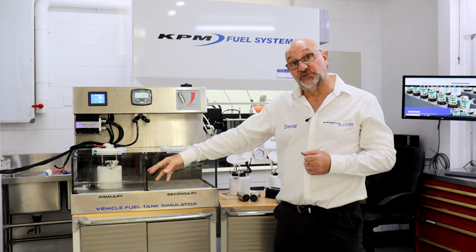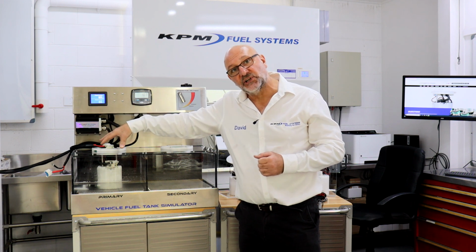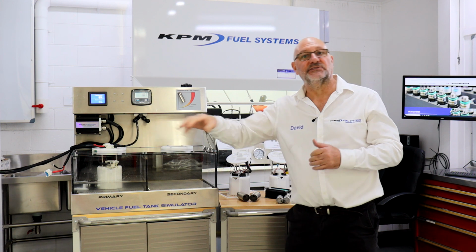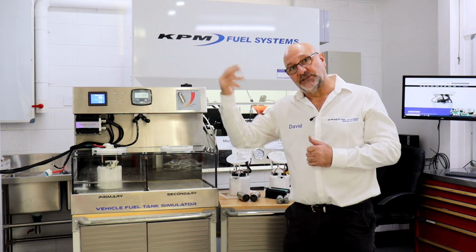But you can see you can drive around at 58 pounds of pressure, keeping your fuel nice and cool. You can drive around Australia or America on our big highways and freeways with your 1,500 horsepower car. You'll never have to replace your fuel system. You'll never go around the corner and have starvation because you've got a hanger style system. And you won't have wasted money on plumbing a return style system when there's no need.